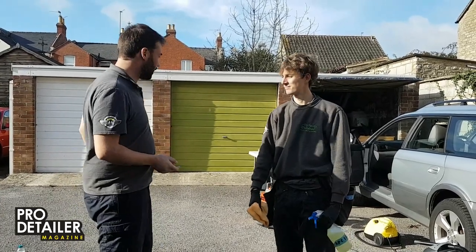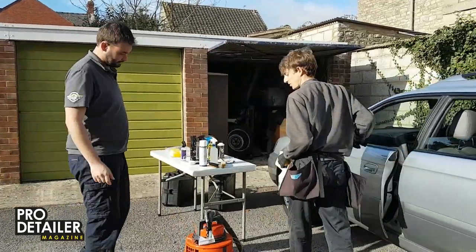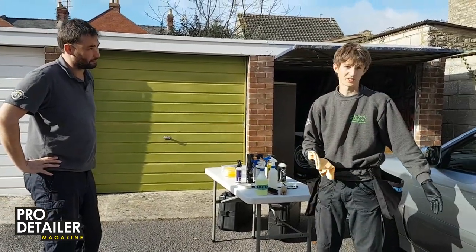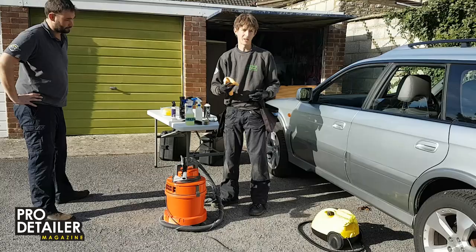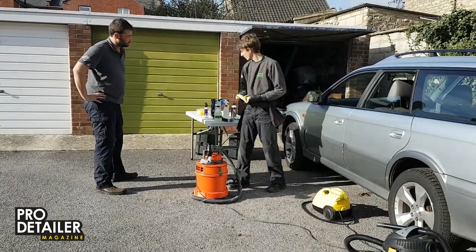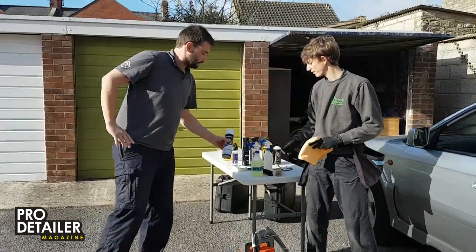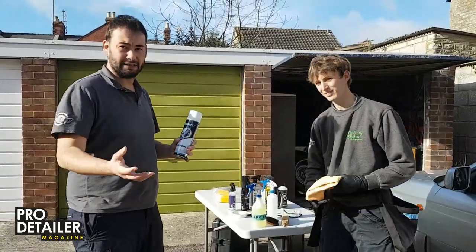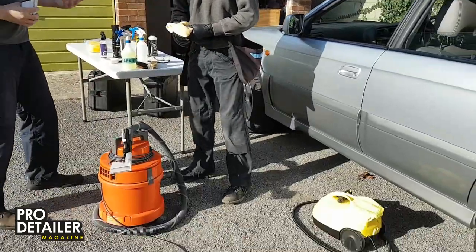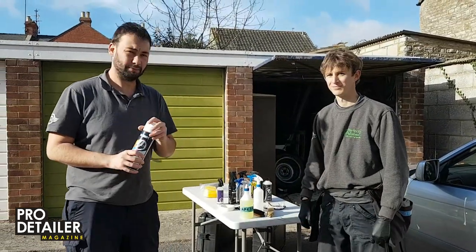Let's have a look at the arsenal of weapons we have here. We've got different processes to try out. We'll start as gently as we can to begin with — we'll start more often than not with the steam cleaner, which is quite a light clean and doesn't get anything too wet, which is what we want to avoid. We've also got some foam-based cleaners, which stay quite dry whilst doing a good clean. It's tempting to squirt APC everywhere or use a wet vac, but that will saturate too much. These foam ones don't saturate it, so they're a better option.